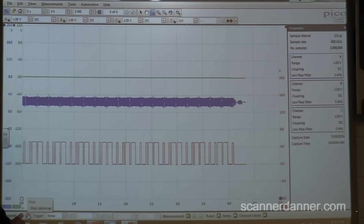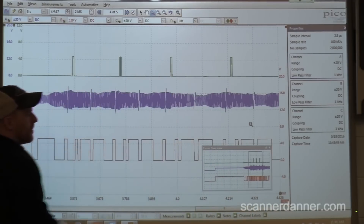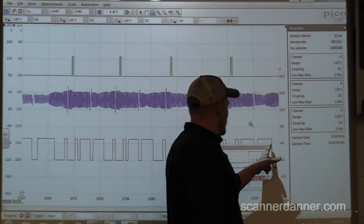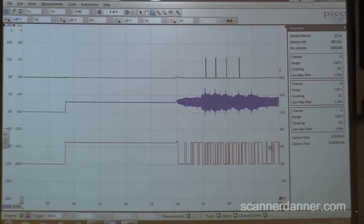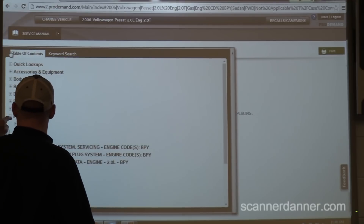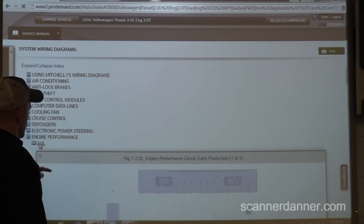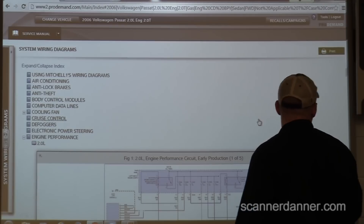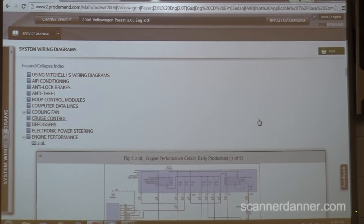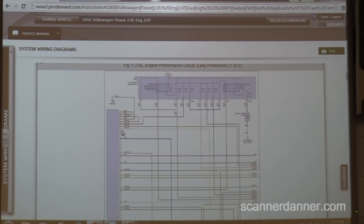Cam, crank — no coil control. Did you hear when the vehicle tried to start that we had some control? We need to fix our sensor ground issue. We need to check our main computer grounds. This is not fun on these Euro diagrams — domestics are very nice. I need to go through this line by line because nothing is designated in here for sensor grounds.